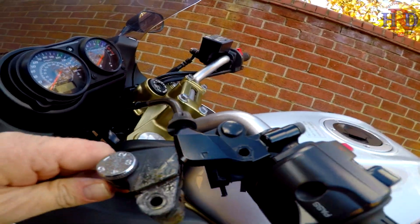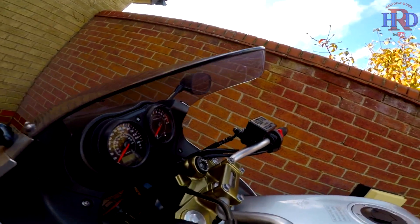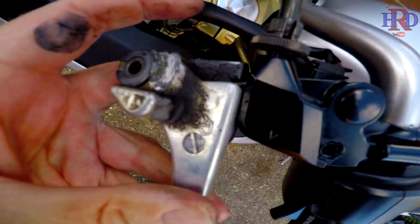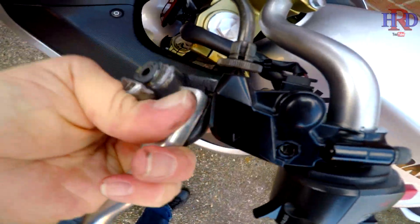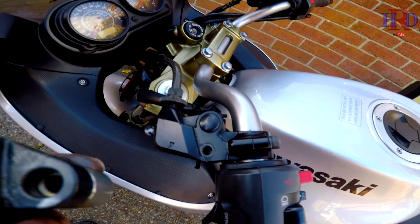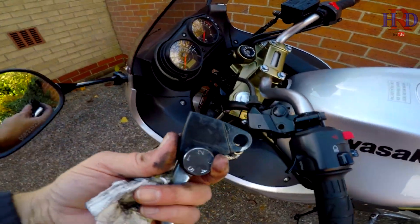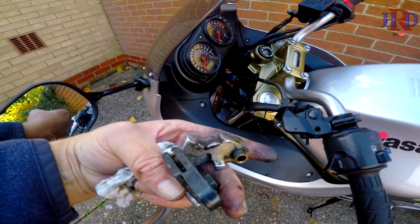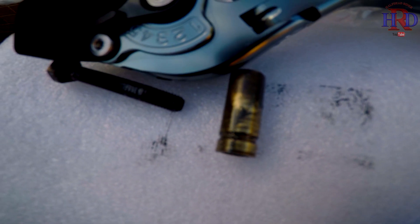I've got to try and get this out somehow. Twist that round so I can see what I'm doing. You've got to get this part out of there — it's going to be a little bit awkward, but you can see where the wire goes in there and you've got to get that out. There it comes — that's really filthy, they put a loose grease on this. The lever's now off. I had to adjust the lever to move it away and then just lift straight off. This comes off also so you can get to that pin easier. If you notice there's a notch — or groove — on it. That goes to the bottom.